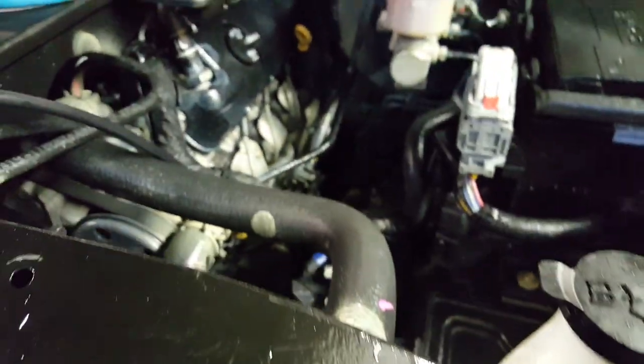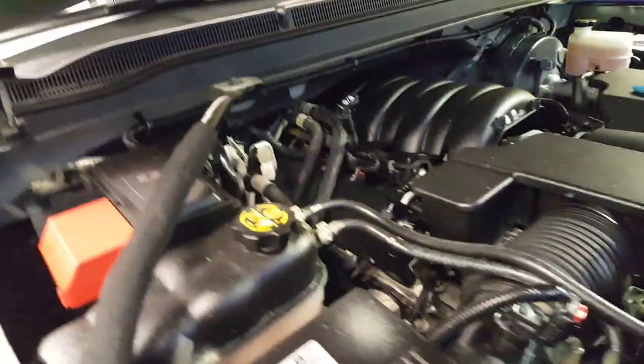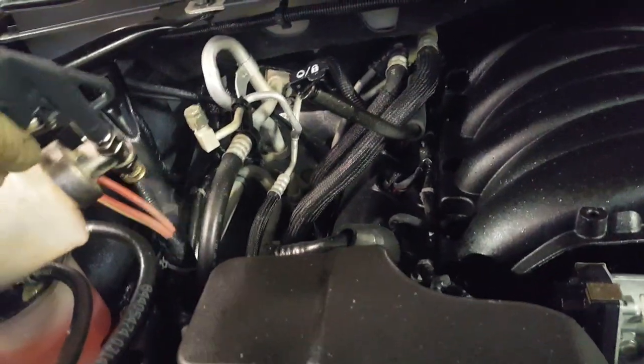You can also take the little can and spray the pivots for the windshield wiper arms. If you see a spot I missed, let me know — I don't want to miss anything because my reputation is on the line. As far as I know, wool wax being a lanolin product — no petroleum — should not affect any rubber. I've been spraying it for over 10 years on my SS Sub and the turbo weasel and I haven't seen any swelling rubber or issues with wiring.